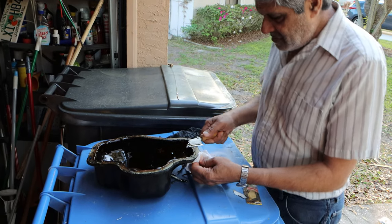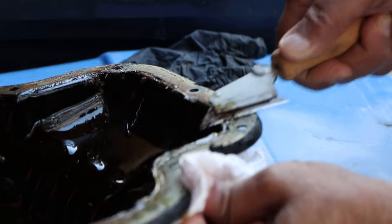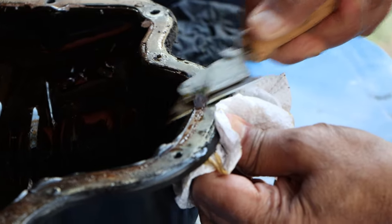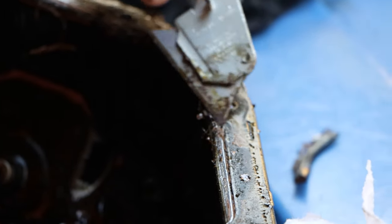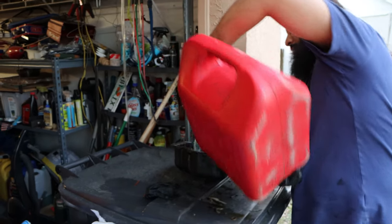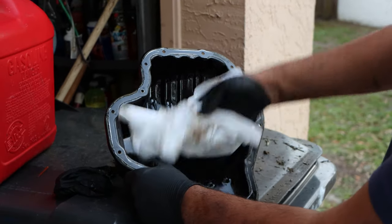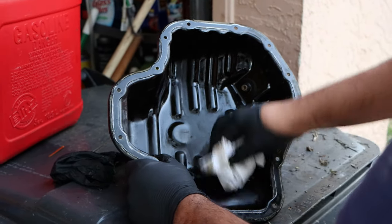I just have a utility knife blade on this holder, and just trying to get any kind of gasket material or any kind of permatex that might have been there before. So we're just trying to scrape this and then clean it up before we install it. It needs a lot of very detailed cleaning. Put just a little bit of gasoline and use that to kind of rinse it all out, making sure you clean it nice and properly. Any of these small shavings of the old permatex, make sure you get it all out nice and clean. And then we'll do the same thing with the lower part of the engine — we just want to clean the mating surface, make sure all old gasket materials and other foreign objects are nice and clean.